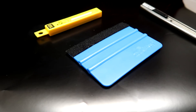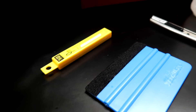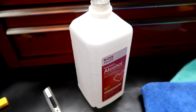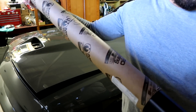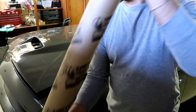Let's talk about what you need to complete this project: a squeegee with a felt edge, a retractable knife with snap-off blades as well as extra blades, alcohol to clean and sanitize the paint before starting, microfiber towels, a heat gun for heating the vinyl, and most importantly good quality vinyl. I utilize the 3M satin black — the link will be in the description.